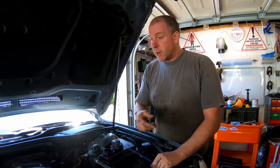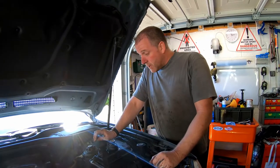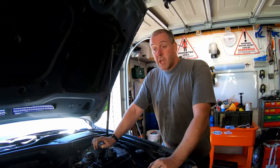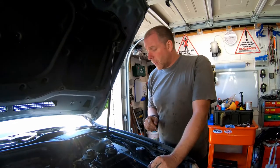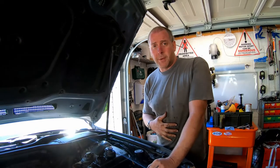Once it's full, I'm going to start the engine and get it up to temperature. Once the thermostat opens the level will drop. I'll stop the engine, allow it to cool down, then check the level in the expansion bottle and top it up to the max marker — you can see the max/min markers just inside the cap. That is the job done, it really is that easy. That is pretty much the car fully serviced. I just need to put the under-tray back on and put the cover back on the engine. Hopefully you found this video entertaining and useful — please feel free to give it a like, comment, subscribe, and I'll catch you all in the next video. Thank you very much, bye-bye.